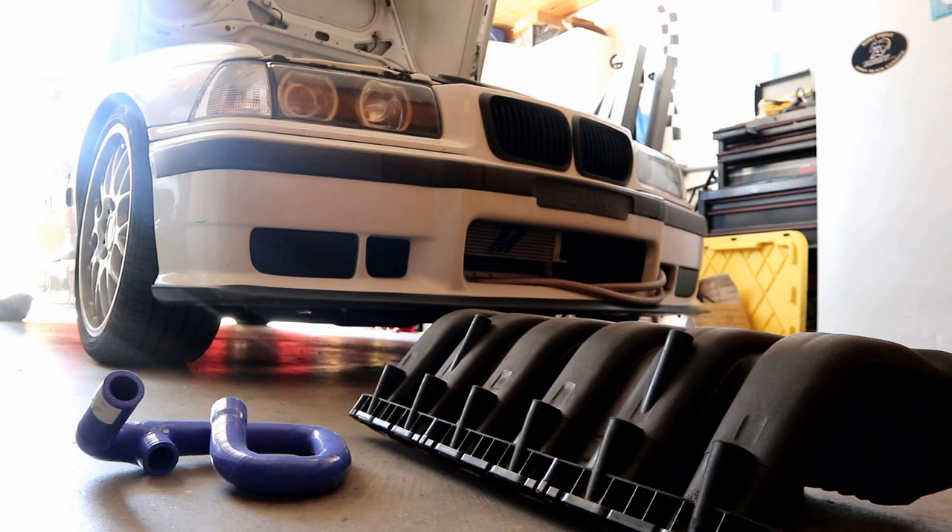I'm running a Castle Performance tune, which is also optimized for the M50. On this motor setup with this tune, there should be basically no torque loss, and with the tune it'll give you even more power gains up top. The M50 manifold really does change the characteristics of these engines, especially at higher altitudes at high RPM. The M52s with the stock manifolds like to choke and just don't get enough airflow to breathe at high RPMs with the factory manifold, so the M50 manifold swap really brings out the top end of these motors.